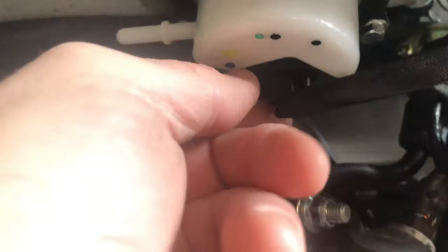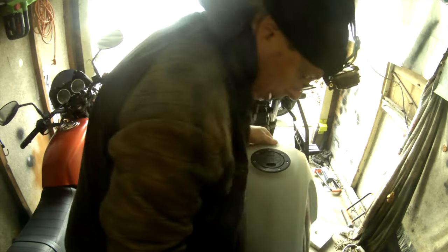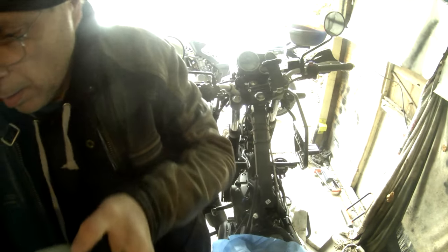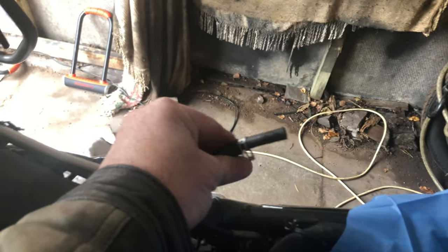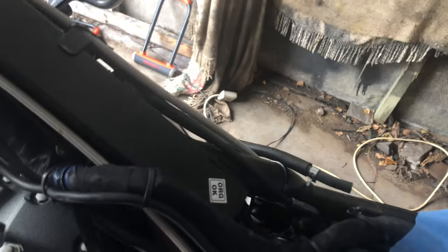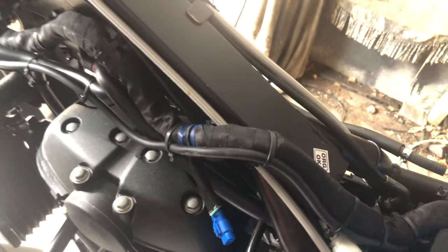Right at the back here is the cable for the pump. There's just a tab on the back that you need to squeeze and it should pull off from the multi-pin plug. That's your sender for the fuel light. There are two overflow lines — breathers — we just need to undo those. We'll disconnect the plug for that sensor and the lines come away. The two breathers just pull off; there's a clip on one — you just squeeze it, pull it down. It's just a simple press clip and it'll pull out. And the tank pulls away.